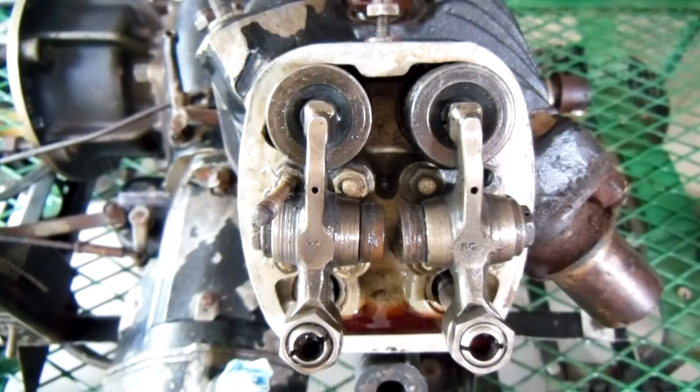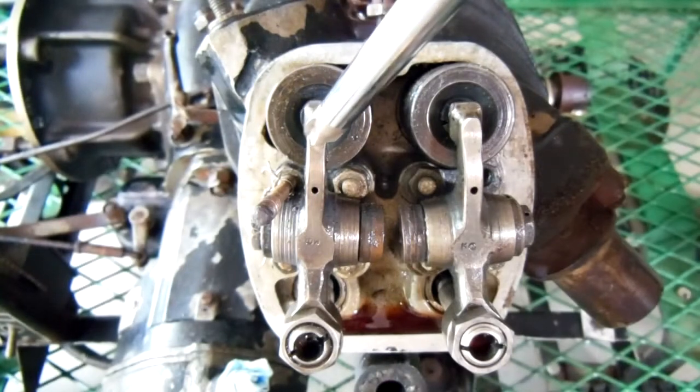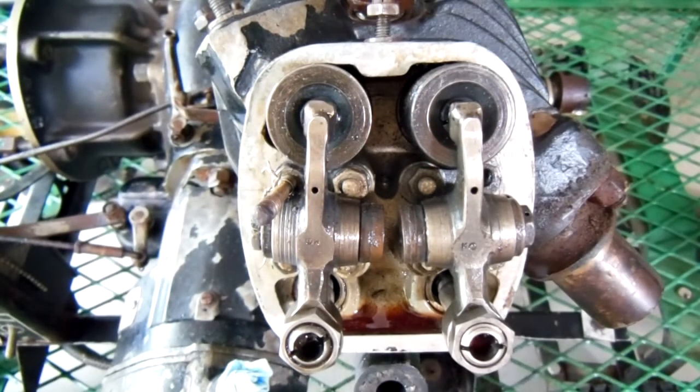The next thing we can do is to stake the valve, which is what we would do on a regular aircraft engine if we were doing a compression check and found a cylinder with low compression and determined that one of the valves was leaking. This is caused by carbon stuck between the valve face and the seat, and what we would do is, with the piston at top dead center, take a large punch and put it on the rocker arm directly above the valve stem, then pushing down so that the rocker arm is in contact with the stem, we would smack it with a hammer. Sometimes it will take a couple good whacks if the carbon is particularly stubborn, but the force of this impact will free any particles that are stuck there, and you'll instantly see a rise in compression.